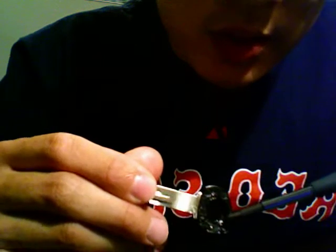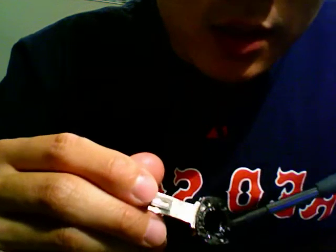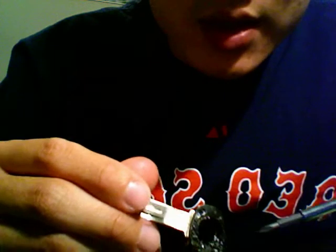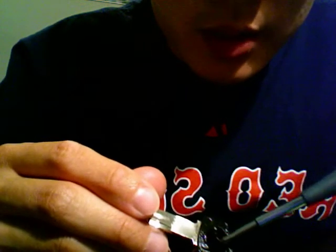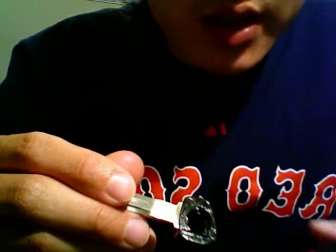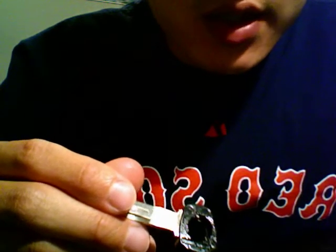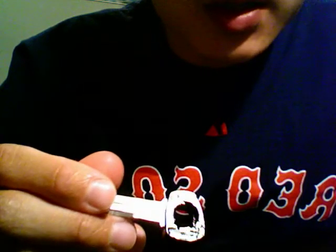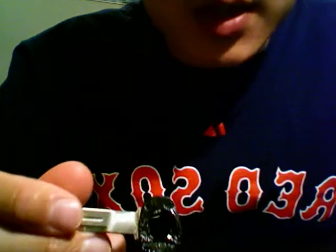holds an immobilizer chip. This was originally for the TL, so they have a chip in here, and this can be reprogrammed at the dealership, but it's not so easily done on the RSX, so that's why you need to swap it out. Same thing with the older first generation TSX, the older generation up to 2006, 2004, 2006 TLs, CLs, whatever.